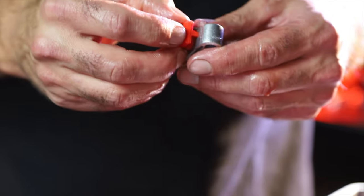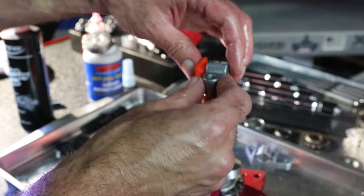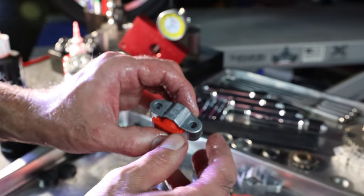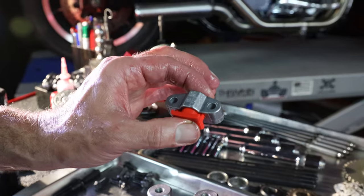On that note of cocking the pad, we want to be very careful. When we put this on, we want to go in nice and square — not putting a bolt in and rotating it — because we want to make sure that this pad goes in nice and square to the chain and to the cams.